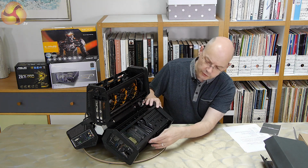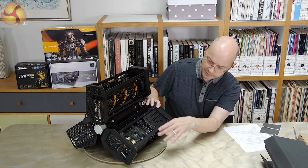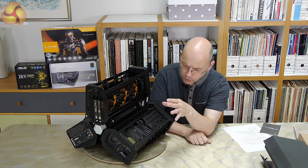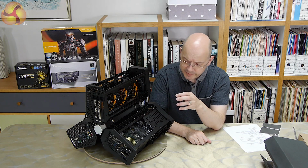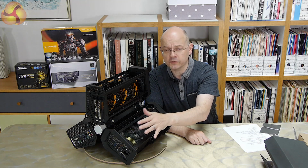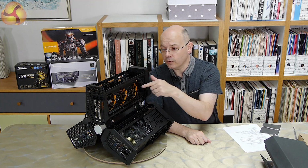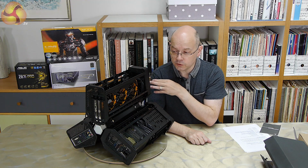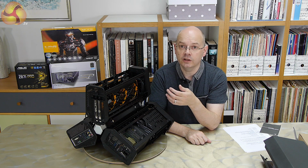Goes there. You will note there is almost no space in front of the power supply for the cabling between the drive base and the power supply. So a bigger power supply isn't really an option unless you decide to fillet the case and take out your drive base. Although it would be possible if you really wanted to put a monster power supply in. No real need. One graphics card, obviously single processor. You're not going to run SLI or Crossfire in this thing, so what's the point in having a 1000 watt power supply?